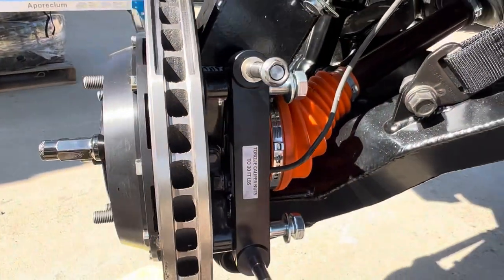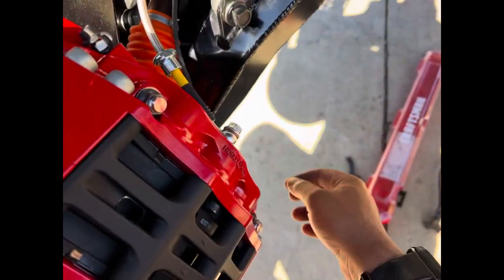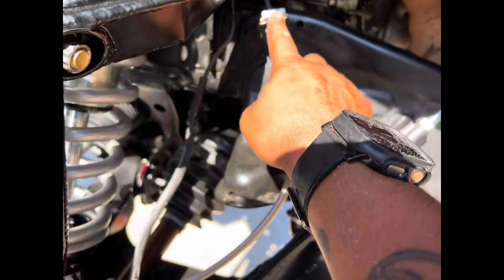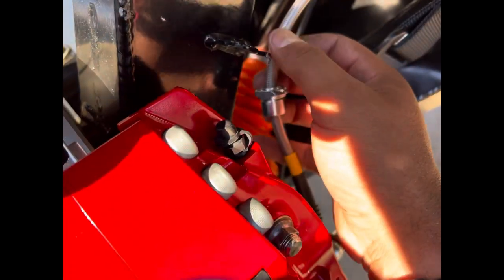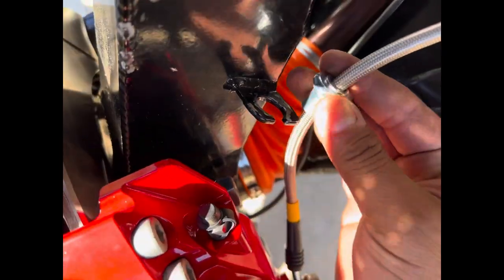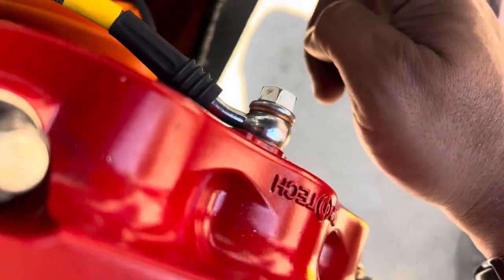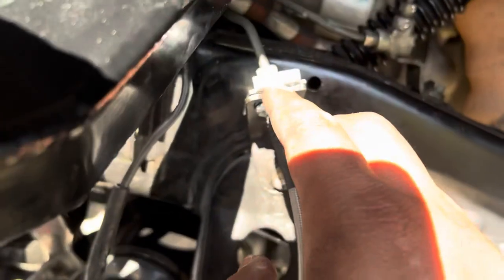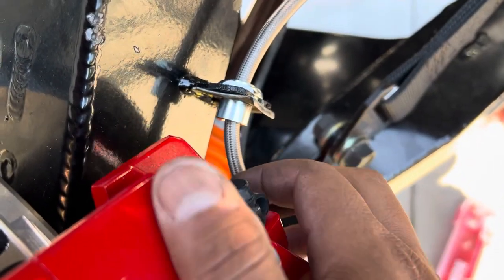The brake lines that came with the RCLT kit don't work, but these do. I haven't checked travel with them yet but they fit right there. I did run into another issue — this one's slotted right here and this larger lip where the clip's supposed to go is too big, didn't fit. This is a round hole so I'm gonna take that down on my step bit in order for it to fit. I got it in — I'm gonna check the clearance now. The tab that came with the kit is pretty thick and the OEM ones are a little bit thinner, so I used the OEM one and it's in there and not coming out.